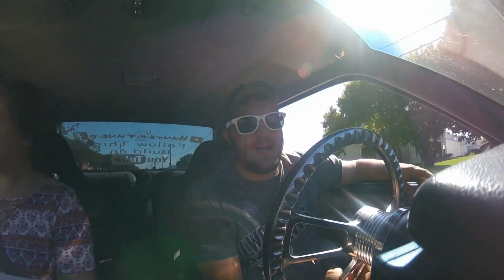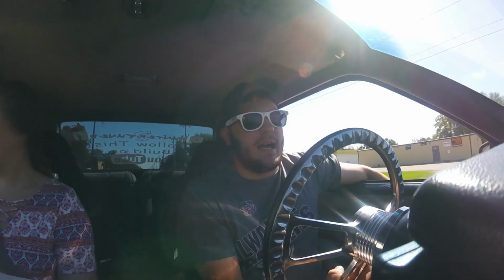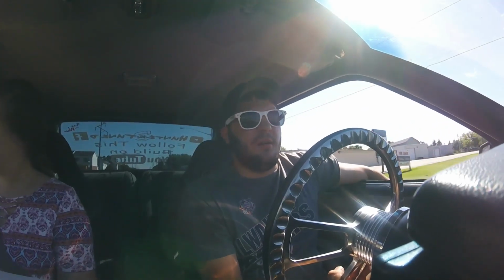So the car's been getting hot, like above 210, and I put that crossover pipe on from cylinder head to the other cylinder head, and I thought that helped, but in the process I put a different fan on, and it fixed it. So I took the fan that I put on back off because it was ugly, and I put my slim fan back on, and then it started getting hot again. So I kind of eliminated it down to needing a better fan or maybe a better radiator.